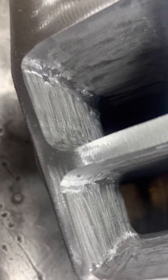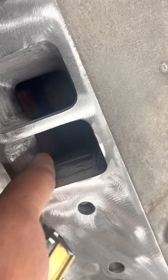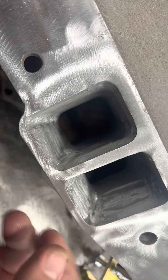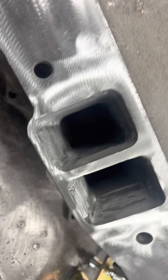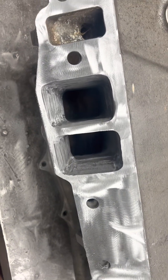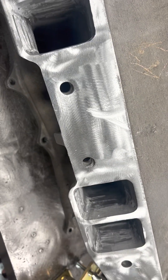It took a lot of meat out of the corners. We opened this up and were careful to work the bottom of the port as well, so that we didn't create a step opening. Basically what we don't want is the air to expand rapidly in one place, because that would cause mixture issues. Probably not my cleanest work, but it will do plenty well for just the port match and blend.